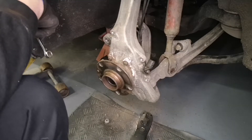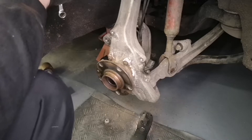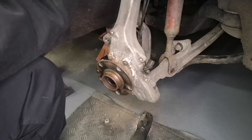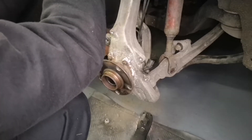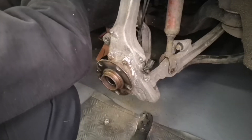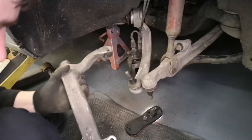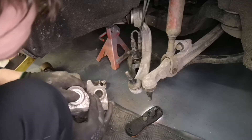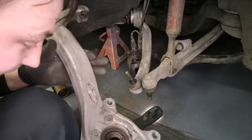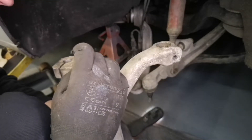Whenever I build things like this back up, I use plenty of copper slip just to help lubricate things and stop them from seizing in the future. Some people say if you put too much on you could get problems, but personally I've never experienced it — nothing's ever come loose that's been torqued up properly, and I have been to things years later, for example my Nova, and the bolts just fall out when you want them to. The strut is now off. I did have concerns that the pressed steel insert inside might be loose causing a knocking, but looking at it, it looks absolutely spot on — which is a little bit annoying. Everything looks really good, so it's not that.